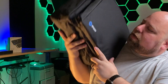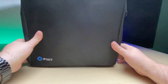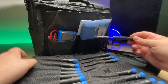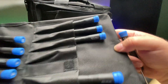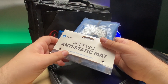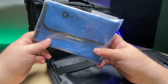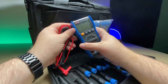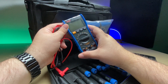Last but not least is the large iFixit Repair Business Toolkit, which is basically an entire repair station on the go. Right off the bat, we have a sleeve of permanent set screwdrivers with long shafts for hard-to-reach places, with names printed in larger font to easily grab what you need. There's the iFixit ESD prevention portable anti-static mat that prevents ESD damage during repairs, especially for larger devices like computers where exposed logic boards are at greater risk. It also comes with a digital multimeter for diagnosing shorts, voltage readings, and continuity readings across connectors and components.